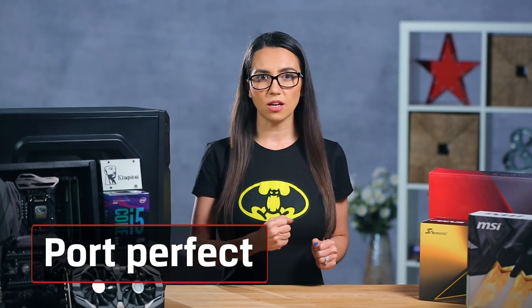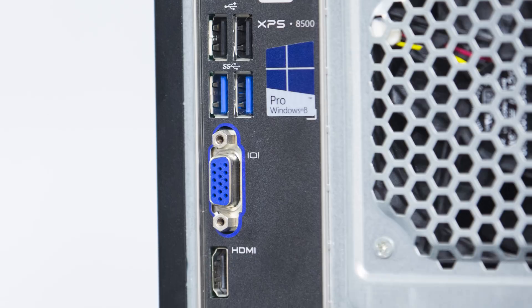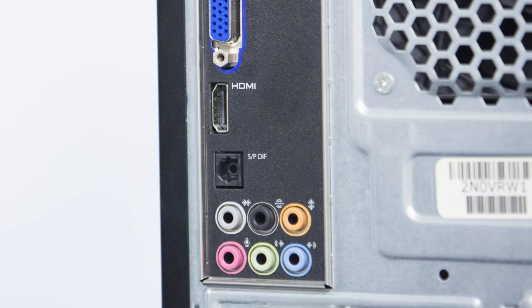Our RAM has just been installed onto the motherboard, but before we're ready to put the motherboard into the case, there's one more step. The I/O plate should come with your motherboard, and it not only labels each of the ports but also closes off the back of the computer from dust and debris. Line it up and push hard until it locks into place. Check that the small metal tabs on the backplate touch the metal parts of the connectors from the motherboard — this is to ground them. If they don't line up, just take some needle-nose pliers and bend them into place.